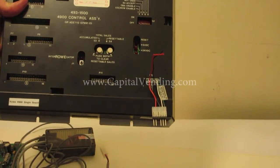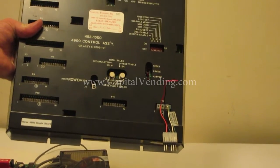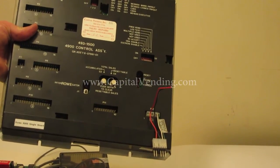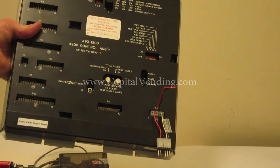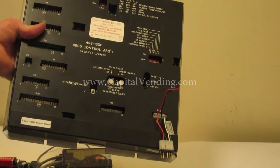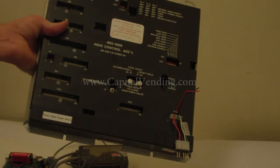None of our machines really require you to do any cutting. There are some very old machines like the Dixie Narco MPC that did not have adequate current, so we supply a separate power supply. In some cases, if you have a very old vending machine and you're converting to MDB and adding a recycler, credit card reader, and extra devices onto the line and things aren't working, it might be a good idea to buy our remote power supply. It connects to 120 volts and supplies two amps of current, so you'll have plenty of current to run all your new MDB devices.